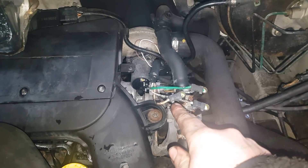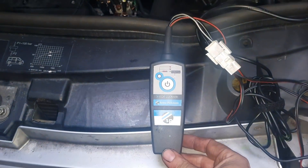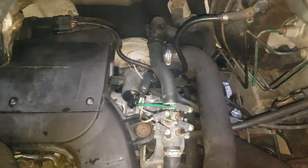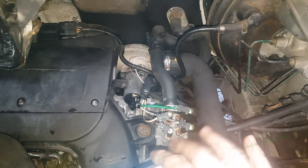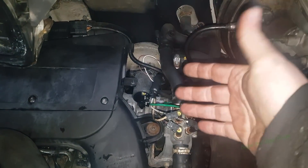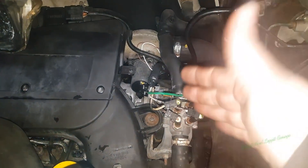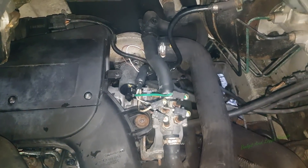We know we've got a broken wire, but I just want to check that the EGR valve is working. So I'm going to use my EGR valve tester and cleaner from Sykes, and we're just going to plug it in and actuate it. It will clean it but also test if it's working, because there's no point going any further until we know the EGR valve is physically working.